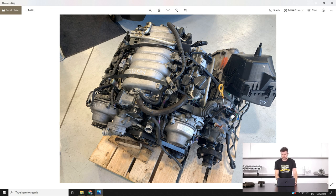Interestingly this was a complete engine conversion kit, so we've got the automatic transmission — absolutely zero use to us. Depending on what we do with the drivetrain, the bell housing may end up being useful. There are a couple of different gearbox options: the R151 out of the Toyota Hilux four-wheel drives is relatively long, and given the FJ40 is an incredibly short wheelbase vehicle, that basically ends up with the tail shaft being incredibly short. The other option is the H55F which comes out of the 70 series Land Cruiser — that's a little bit shorter.